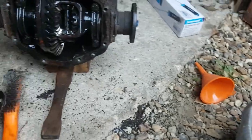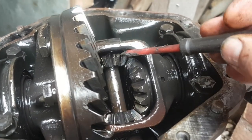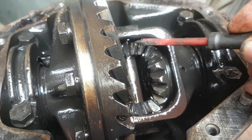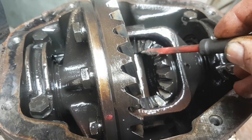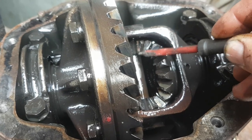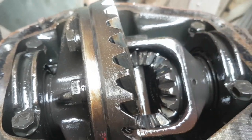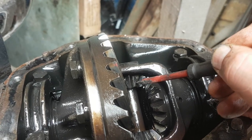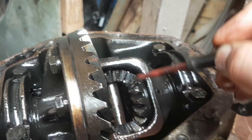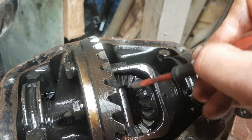It's weird that it's starting to behave. I'm going to tip it upside down in a minute — I just want to get this bowl emptied and cleaned out, get all the swarf out of it before I go on to the next stage. Found the problem: I've got a planet gear here with probably two, maybe three millimetres of play on it, and there's all manner of swarf coming out from behind it — whatever bush or bearing it was sitting on has gone. The rest of the gears are relatively okay, but there's quite a lot of wear on this gear — it could be that it's been chonking around for a while and not meshing correctly.